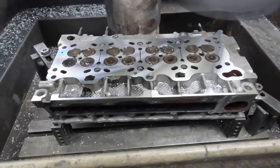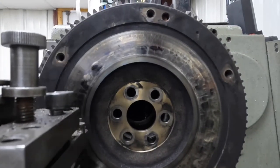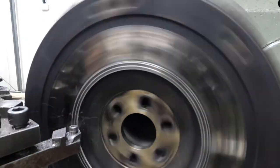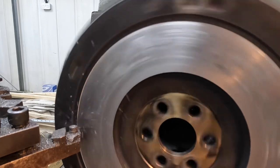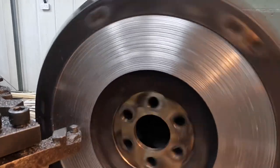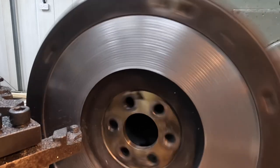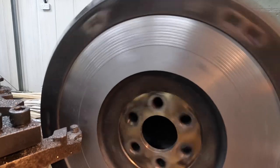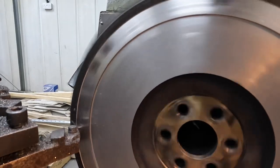Anybody in the Bracknell area needing their car fixed, get to Bailey's Garage. The next job is a flywheel for a local garage — I did record the start of this but I've lost it due to corrupt GoPro data. All we've got is the time-lapse machining. The flywheel was in a bad state and I recommended the customer replace it, but he couldn't get one for four weeks so the only option was to make it as good as we could. This part is just roughing out and trying to get rid of the hard spots. The cracks were quite deep but we took out the minor ones; the hard spots disappeared virtually. Because it's a step flywheel I can't grind it — I have to do it on the lathe.